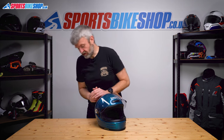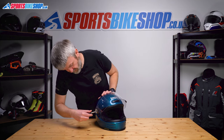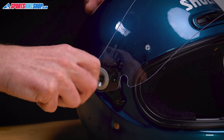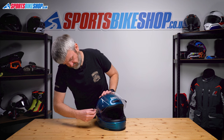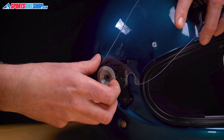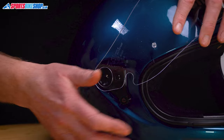Start with the lifted visor, then we need a screwdriver. Remove the screw from this side of the visor — just spin that one out from there, set the screw aside, and then this little collar here just pulls free. Sometimes just lifting the visor gets that out, and then the visor's away.